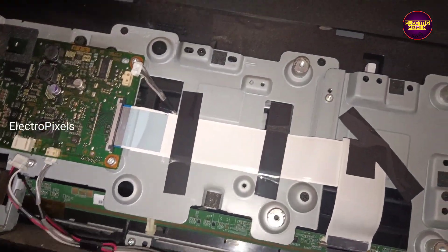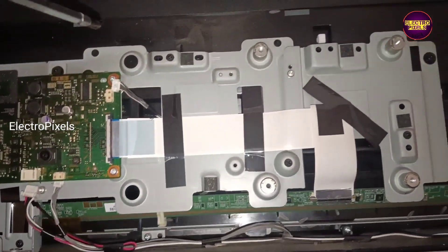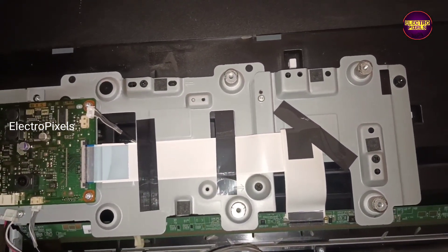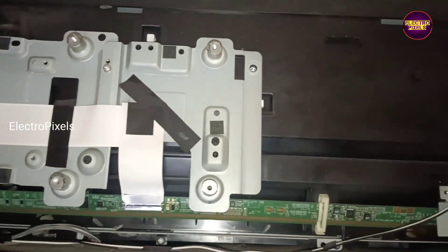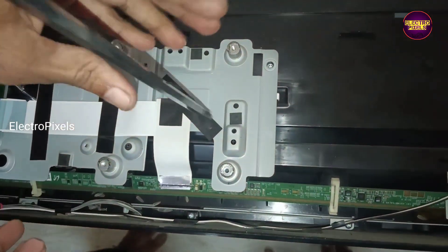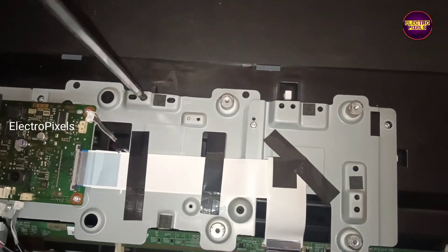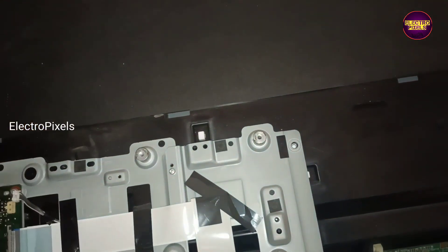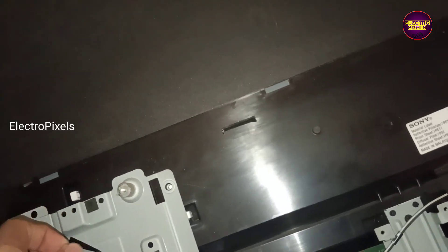This is the motherboard and we need to disconnect it for repair. There are three solutions to solve this issue. The first method is a temporary fix by removing backlight protection from the inverter IC — not a good repair solution. The second method is replacing only the faulty backlights. Finally, the permanent solution is replacing the entire backlight set with a new one.